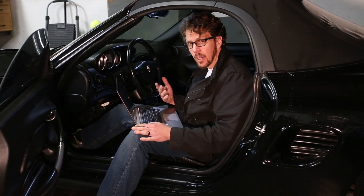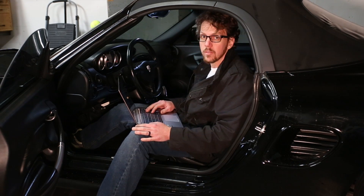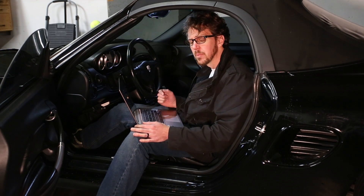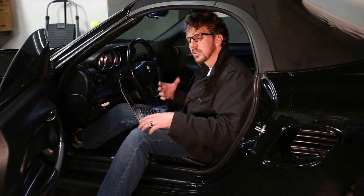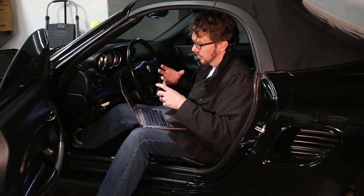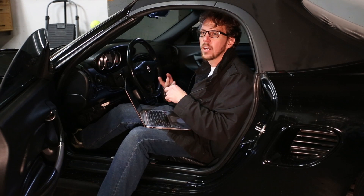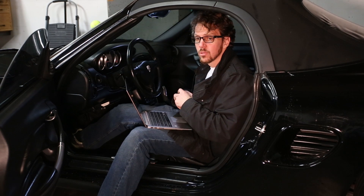All right, good to go. Now all I have to do is reset the code using the Durametric tool and then drive it around a bit and see if that solved the problem. The knock sensor is actually a really interesting part of how the engine manages its timing. Now that I have this Durametric tool, I can actually look in real time at what the engine is doing with the ignition timing. So in a future video, I am hoping to really dig into how a knock sensor works, how timing works, and how that's related to the type of fuel you use — which in my nerdy brain is all really interesting stuff. And hopefully you'll find it interesting too. All right guys, thanks for watching. Let me know if you have any questions. Until next time, see you guys.